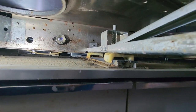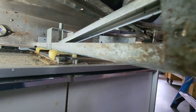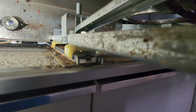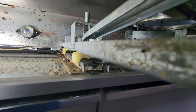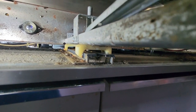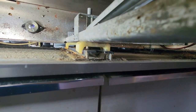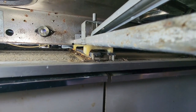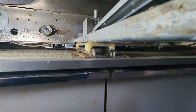Now we're going to look at the rail system, which is the locking bar of the drawer. I'm going to push the drawer release button and you'll see what happens — right in the middle there, see that moving? This is your locking bar; it pulls the pin and allows the drawer to move. When you push the button down the drawer will move; when you release it the pin locks the drawer in place. If you're having trouble with your drawer locking or not unlocking, you can see that arm moving — that's probably your problem; either the spring is fatigued or something is misaligned.